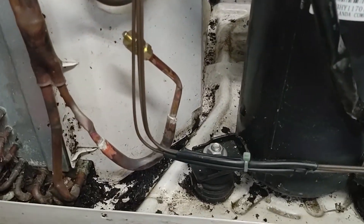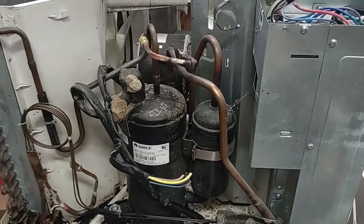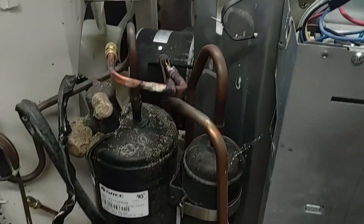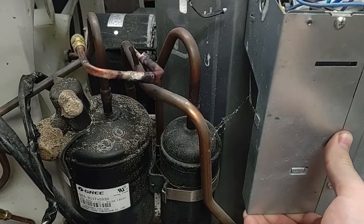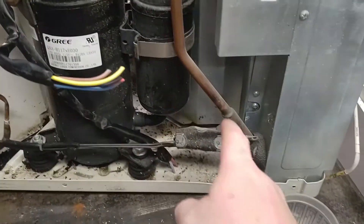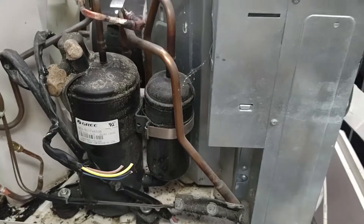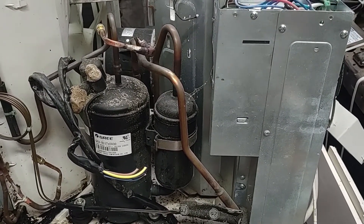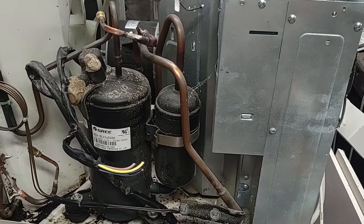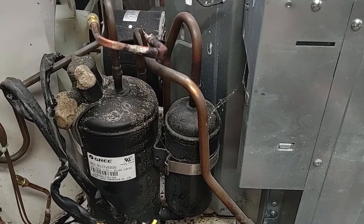Now I have the second access valve installed. Everything is all leak-proof and is filled with about 50 pounds of nitrogen just to test it. I also cut the wiring for the compressor and the fan, and uninstalled all of the screws holding the evaporator in place, as well as the fan and shroud on the back. Next up I'll be cutting the lines to remove the evaporator and separate it from the compressor and condenser. I'm also going to tape all the lines shut and fill it with nitrogen again. The oil in the compressor will actually absorb moisture and cause problems, so I'm trying to keep this sealed as much as I can.